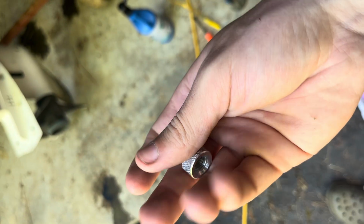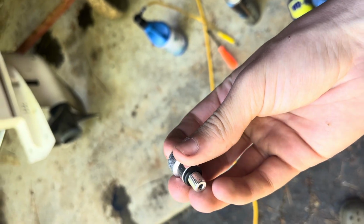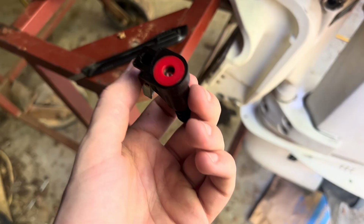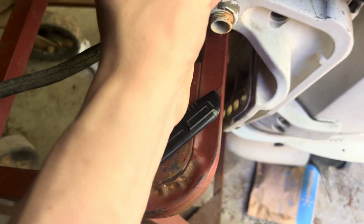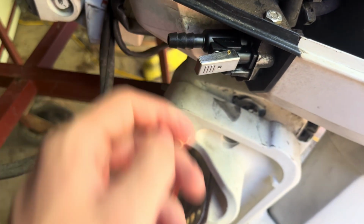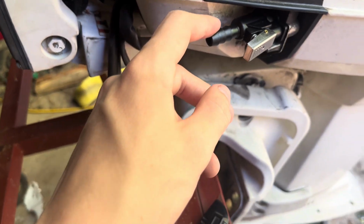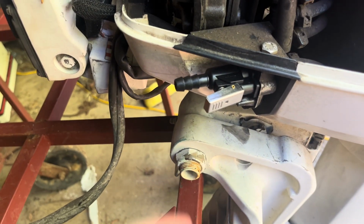In case you're wondering what this piece is for on your oil pump kit, this is for a Yamaha adapter, I'm pretty sure. All right, this is your fuel fitting right here. It just goes on like that on OMC outboards. Johnson's, Evinrude's, you know, it's spring loaded. It just clamps down good on there. But it's time to rig up our fuel lines now.